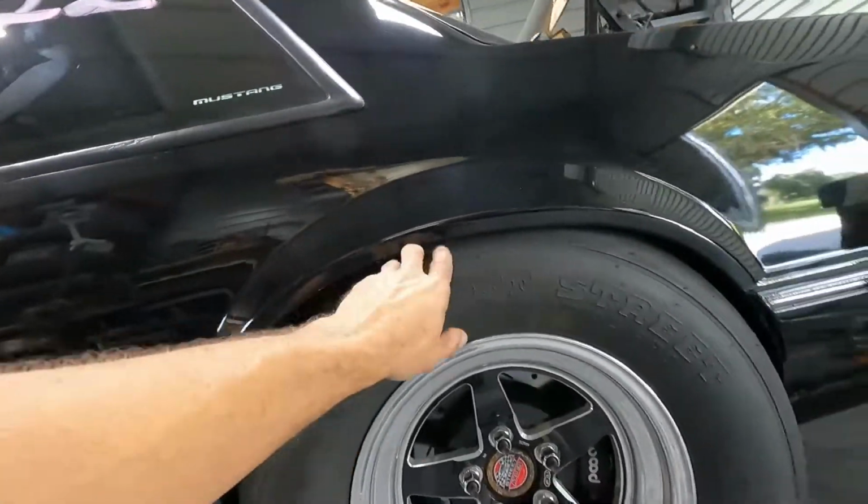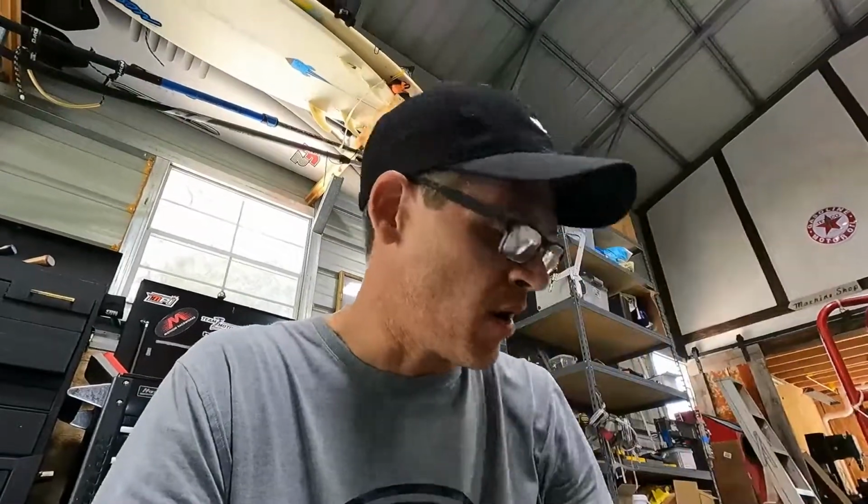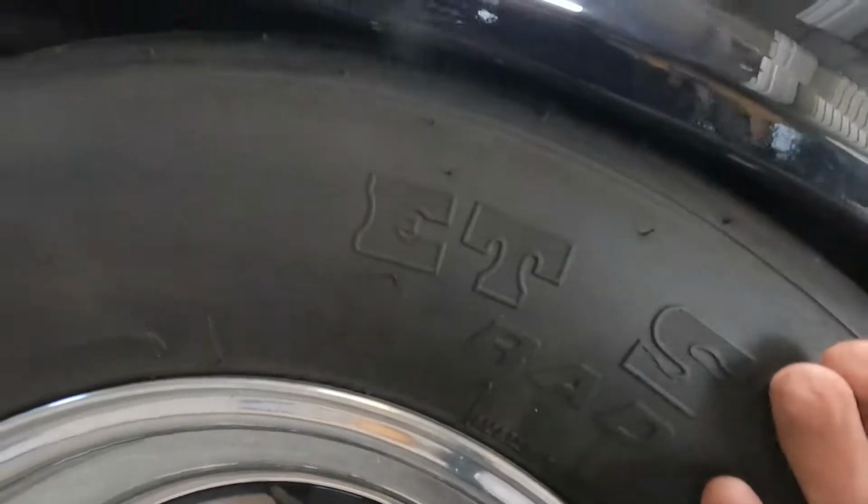So that's it. We basically got it back by moving it a little over an inch on the bar. It brought the ride height back to where it was originally. So that should work. I think we'll be okay. Hopefully it doesn't settle anymore because it's really pretty tight. But like I said, worst case scenario, I can order some stock springs, maybe a couple sets, and then cut them in at different lengths to get the ride height exactly where I want it, because that's important too.